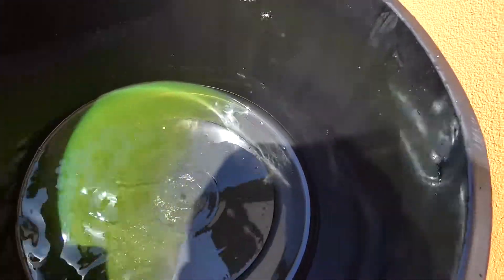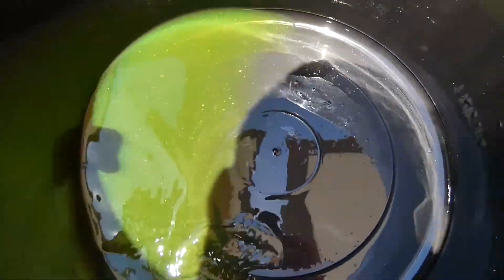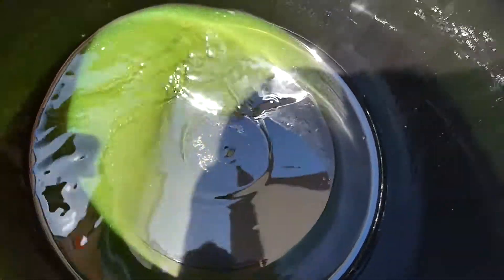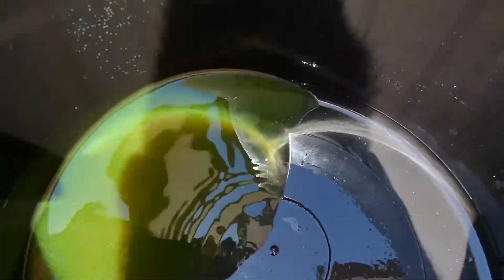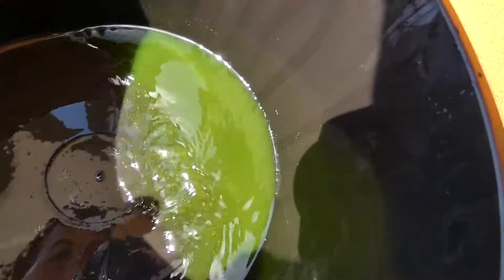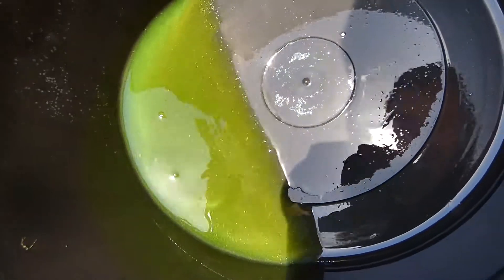Little bonus if you're here to the end — I've just drained the coolant and as you can see there's a lot of debris floating around in there. That's what I was talking about — a lot of that calcium has obviously broken off, gotten small, and been flushed out, which is great. So if your overflow bottle is looking like mine was, this is what is going on inside your cooling system. Definitely a good idea to do the same thing and give it a flush and a clean to get rid of all that, because it looks like I'm gold panning right now — and I wish that was gold.